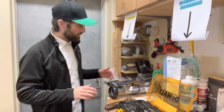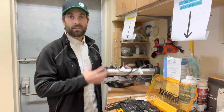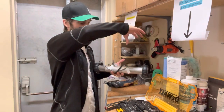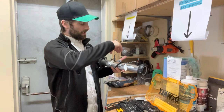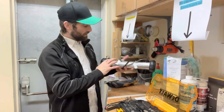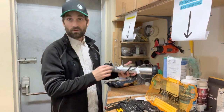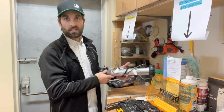Today we're going to talk about how to change a heater element in a heater assembly. The heater assembly usually lives under the circuit board box which is on top, sitting on top of the heater tube, and the heater is then connected to the circuit board in the box. We took it apart just to give you a better look and share a few tips to help you change the element easily in your hot tub.